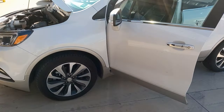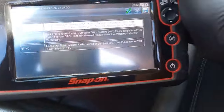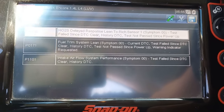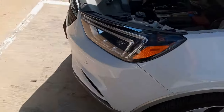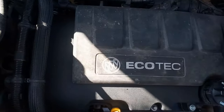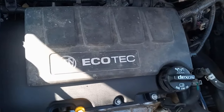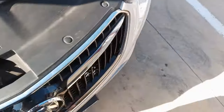We've got a 2017 Buick Encore with codes for fuel trim lean, intake airflow system performance, and O2 sensor delayed response. I've seen these codes before — usually they have to do with the valve cover, but I already replaced the valve cover on this car a couple months ago when the PCV valve went bad in it.